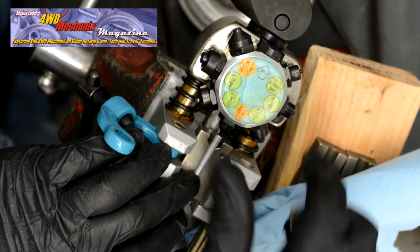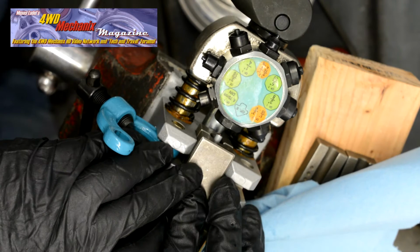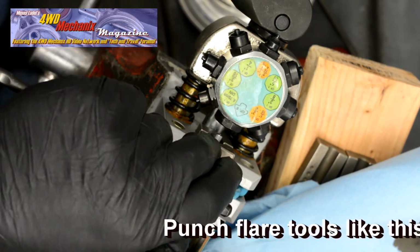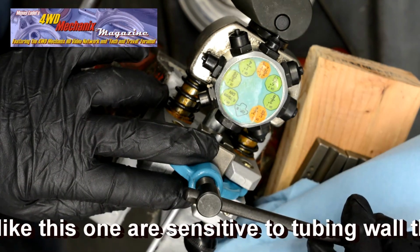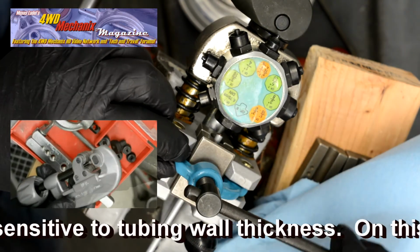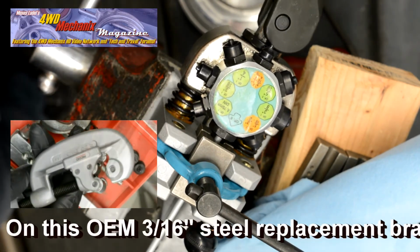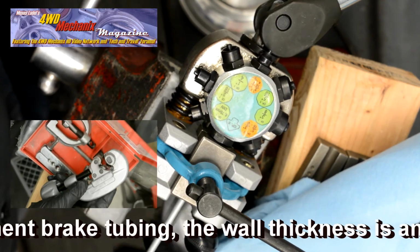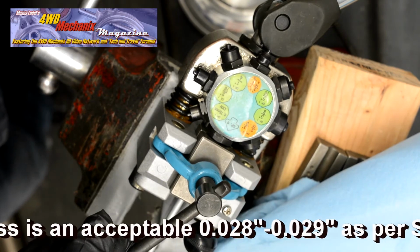This time, the major difference is the square end on the tube cut by the mini cutter and far more time spent on the internal and external deburring process. Despite the high quality of the rigid tubing cutter with a stainless steel blade, the blade has quite a bevel on it, which makes it difficult to make the tube end fully square.